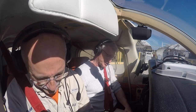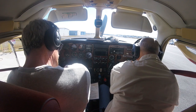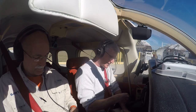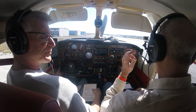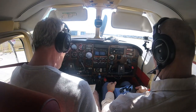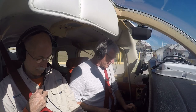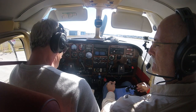Pre-flight complete. Emergency exit lowered. Seats are good. Cabin door is closed and locked. Window is open. Control wheel lock is removed. Brakes are tested and set. Cowl flaps are open. Avionics power switch is off. Landing gear lever is down. Master switch is on. Landing gear light and cabin pressure light are good. Fuel selector valve on the right tank. Cabin pressurization is in. Dump valve is in. Cabin pressurization on. Cabin altitude selector is set at 7.5.